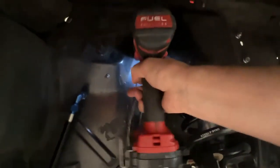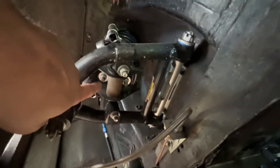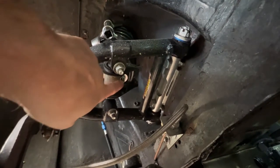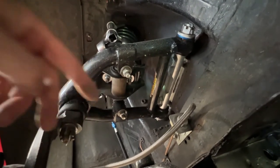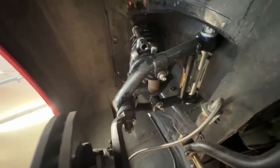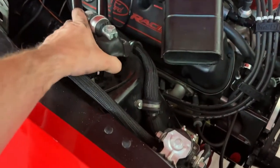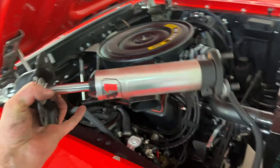After this it's time to remove the two lower nuts for the shock. It can be very tight — you'll need a long socket with a narrow shank. When you remove those nuts, just lift out the shock. This one is a little beefier than stock but it comes out quite easily, so it's very simple to remove.